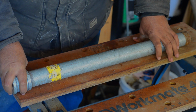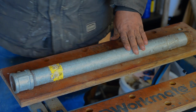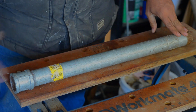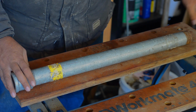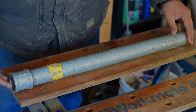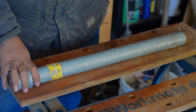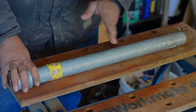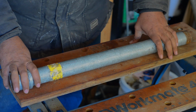If you just don't have the oomph to get it out, or you're struggling with it, it's just leverage. It's just math. It's science, physics. By giving yourself a longer handle, you basically make your travel longer, which is what you're doing when you put it on the end of a wrench or a ratchet. If you were starting with 1 foot and you go to 2 foot, you've basically doubled the energy being applied at your center of movement, your rotation, compared to if it was 1 foot long. And obviously, that ratio adjusts depending upon how long your original handle was.